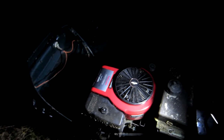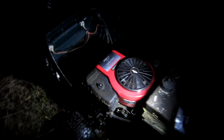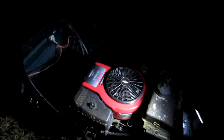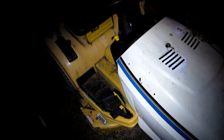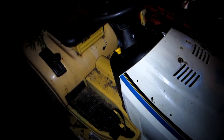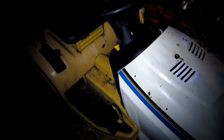Long and short of it — yes, it was the safety switch that was causing my problem. And Delmont Cruiser, thank you very much for the suggestion, that was perfect. I still got the thing running and it didn't cost me nothing — didn't have to go buy any new parts. Now I do know for a fact that's not the issue with this one. This one the coil is definitely gone in it. But I'm going to try what Road King was saying about getting it out first and then checking the diode on it.